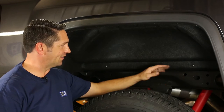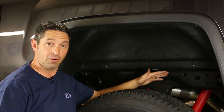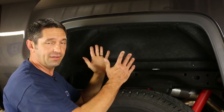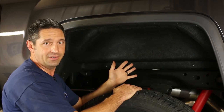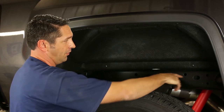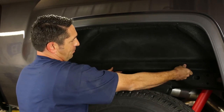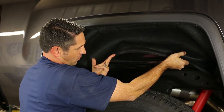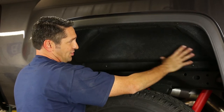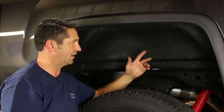The next step is to get this fender well liner out of the way because it blocks access for putting the cross members in the truck. Depending on the year model of your truck, there may be many different fasteners holding this liner in, so it could be a little tedious. There is an alternative — you can take out just the two lower fasteners in the bed lip and pry the liner up out of the way, but you run the risk of damaging the liner. We recommend just taking the liner out altogether.